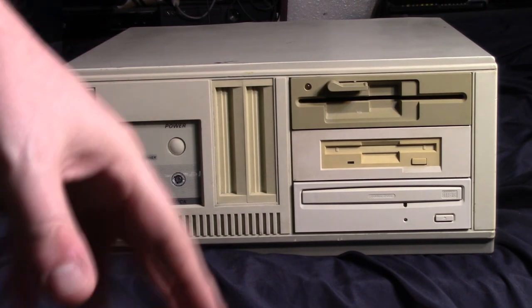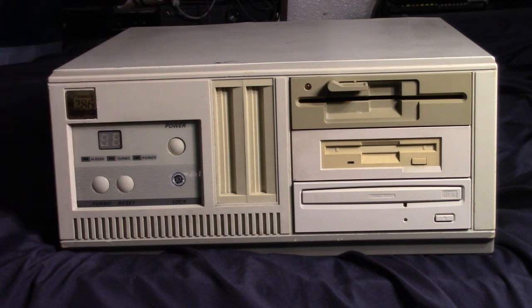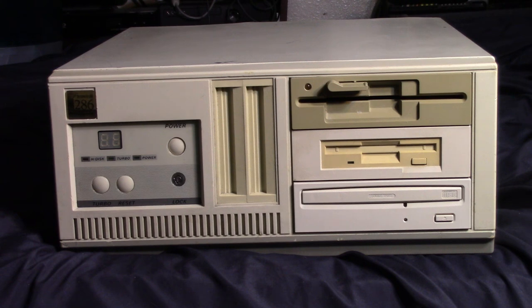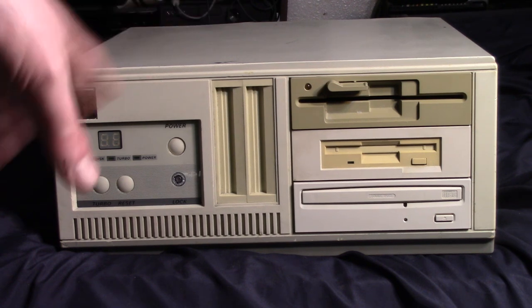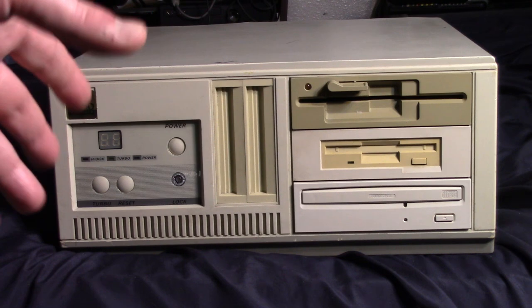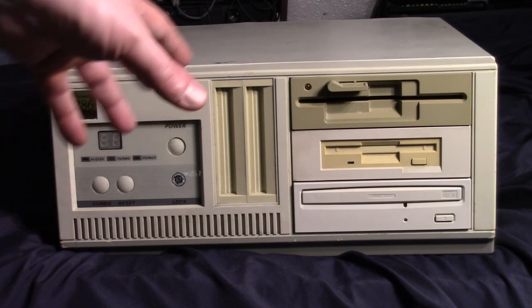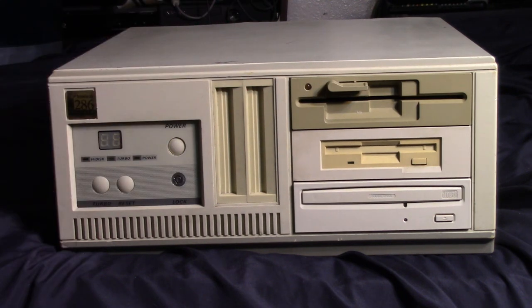Yeah, as for the components, I really like the Sound Blaster. I think it does a good job. That early Sound Blaster, I like having the Creative Music System compatibility. I don't believe it's 100% on that card, but it's pretty close. ATI card, it's a nice VGA card. Probably overkill for this machine, but I will say with that card, I have had some issues with it in faster 486s, but it might just be the machines I've tried it in. But it's a really good VGA card for a 286 or a 386. A lot of versatility with that VGA card, and it has pretty good CGA compatibility, so I'm really happy with that.